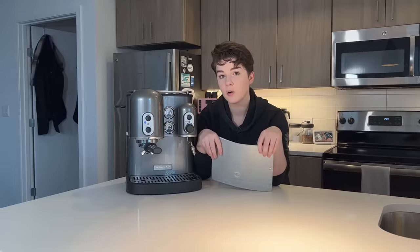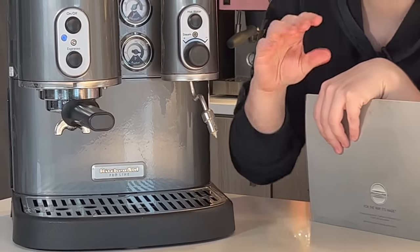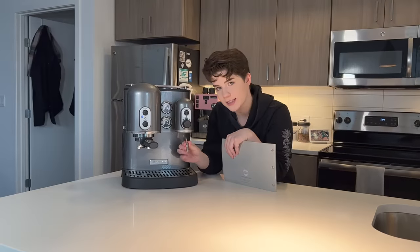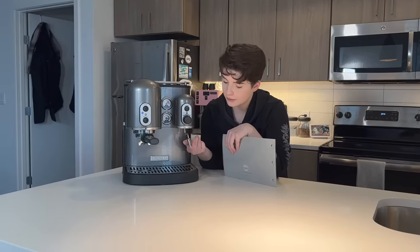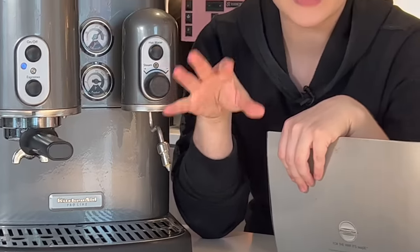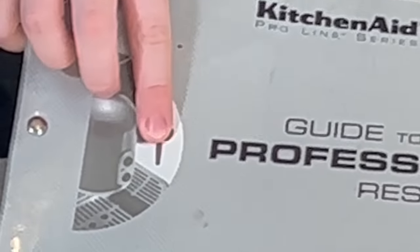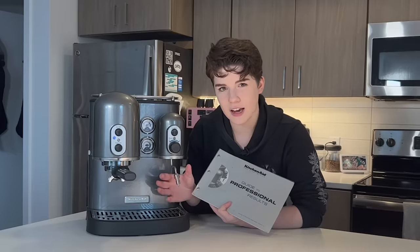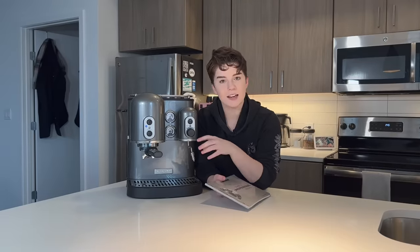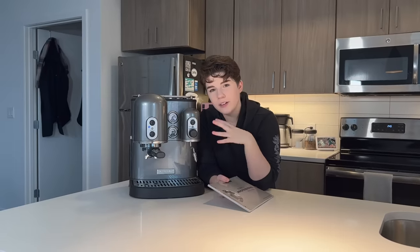It's making sounds too, so that's kind of fun. While we're waiting for this to preheat, there is one noticeably missing part from this machine — the steam wand over here is missing its plastic guard. This is our little steam wand, attached on a nice little ball joint, which I love. Not enough espresso machines put their steam wands on ball joints and it's very nice. Right down here is where you're actually going to have your steam leaving, this little spout at the bottom. Generally if you were buying this at usual retail, firsthand, you would have this little plastic guard that's going to disperse the steam a little bit better and also protect a bit from the heat. It doesn't impede the testing of whether this works or not — it's just going to be a little bit more inconvenient to use.